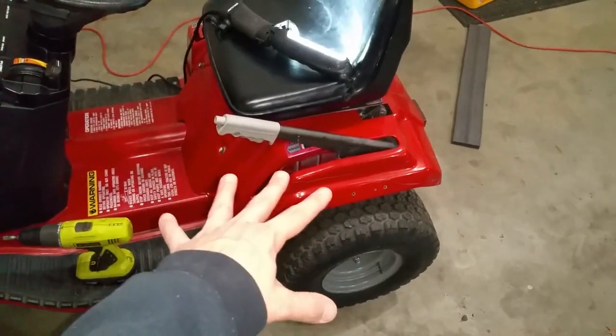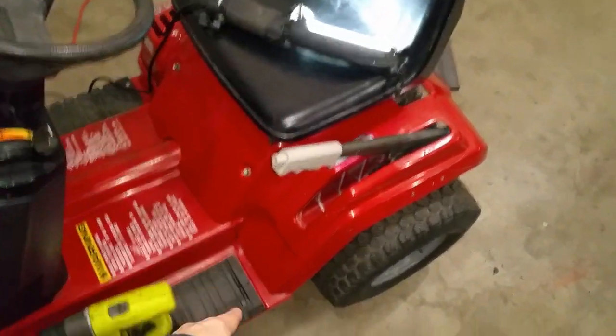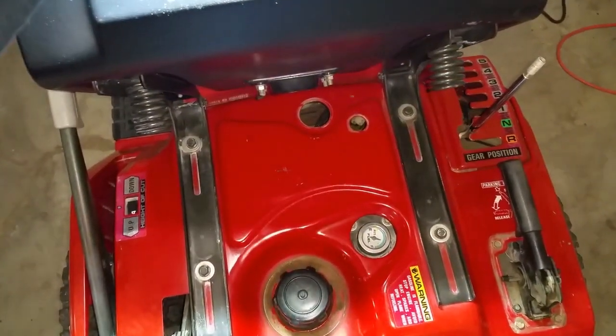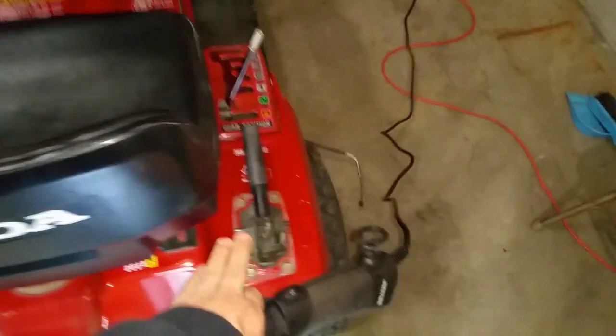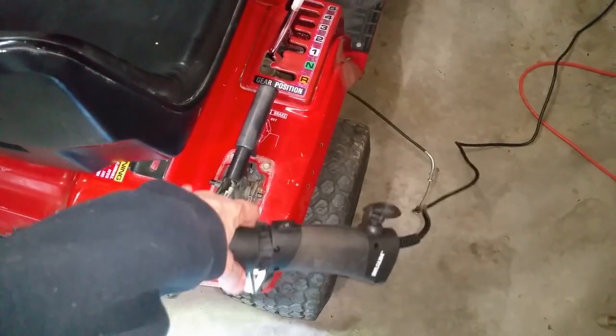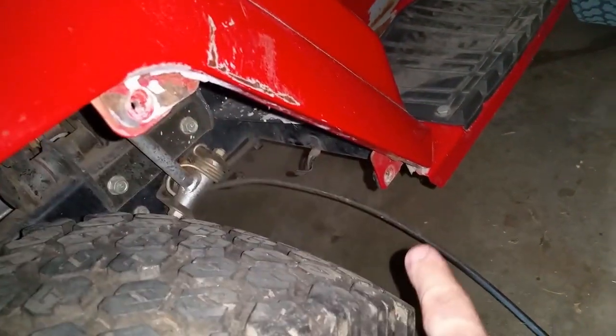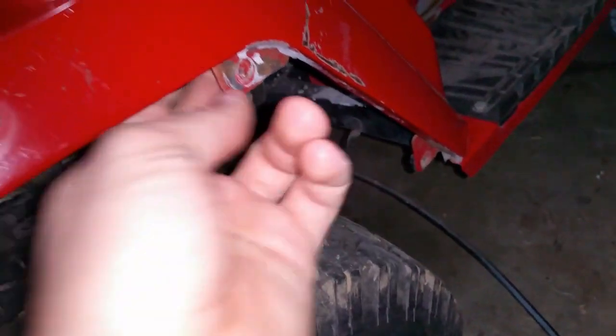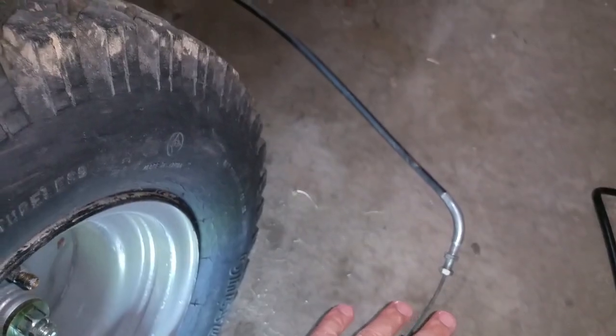The first thing we're going to do is take off the rear fender. There are two bolts in the front here, and I believe there are a couple bolts underneath. You'll have to take out the four bolts that hold the seat on, and there are a couple grommets in the front. You will also have to take the emergency brake apart. I just took the rubber boot off and took the cable apart — it's routed underneath here with a bolt here and a bolt here, routed up underneath out of the way from the tire. Once you snake that through, you can just leave it down to the side.